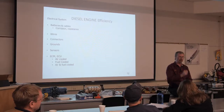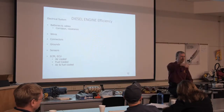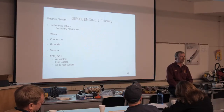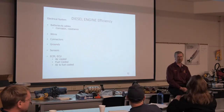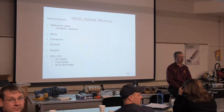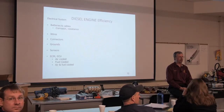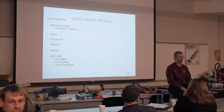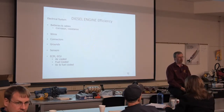Be very careful. Even with a sealed battery, a battery with vent caps, you can pop the caps off and look down and see the electrolyte. A sealed battery can't do that, but it does have a vent. Try not to get that water and baking soda down that vent into the electrolyte, because it neutralizes the electrolyte, is what it's supposed to do. Right, works pretty well, actually. So if you have a parasitic drain, does that always mean that the battery is toast? No, no. You just need to take care of the problem. Something is parasitically drawing off the current flow in that battery, and probably it's the terminals. Yeah, corrosion.